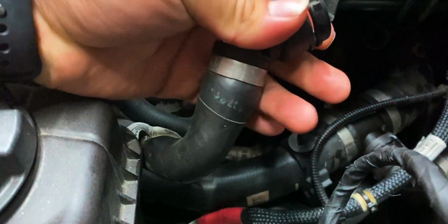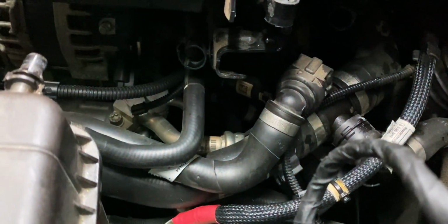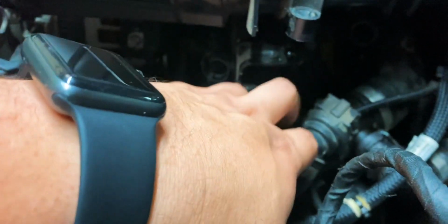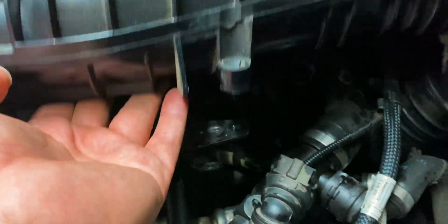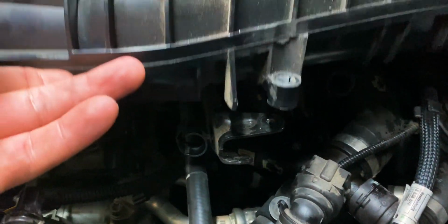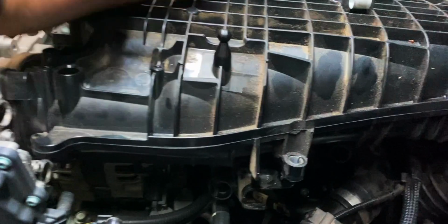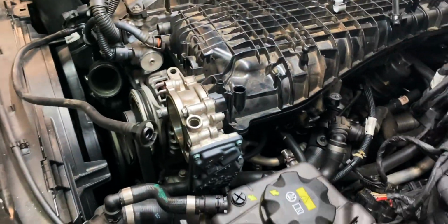Alright, so these coolant hoses are held down by these little clamps. They look like this. Essentially, they go right there and hold the coolant lines in place. And once you release those, this can come off completely, after, of course, you've unbolted the bolts that go directly on the block, and then it comes off, and now we are able to exchange it for the other intake manifold. The one thing that we do have to do is take off this throttle body and replace it over to the new manifold.